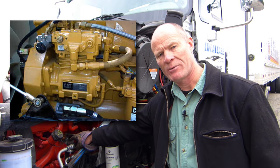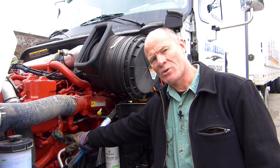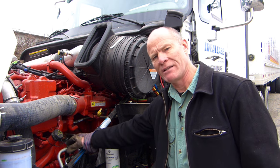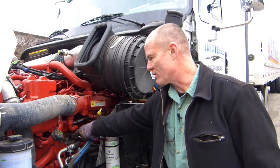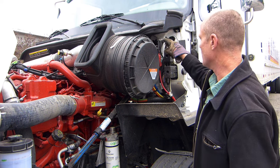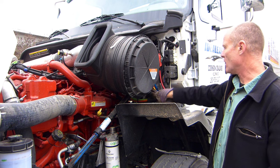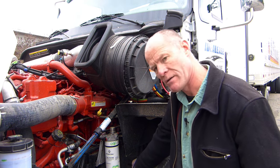The air compressor is secure, not damaged, not leaking. It's bolted to the side of the engine — nothing flew up and hit it and it's not leaking because there's oil in it. It uses the engine's lubrication system to lubricate the air compressor. On the Cummins it's actually kind of hard to find, but just point to it — light touch, secure, not damaged, not leaking. Lines, hoses and valves which are up here on the firewall — secure, not damaged, not leaking. You can listen for air leaks, you don't hear anything. All the lines are secure and none of them are hanging down. Line out to the brake chamber — secure, not damaged, not leaking.